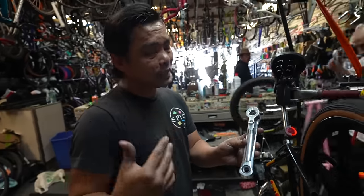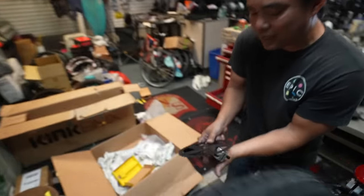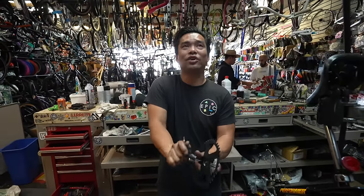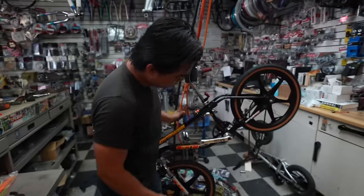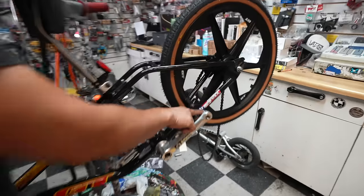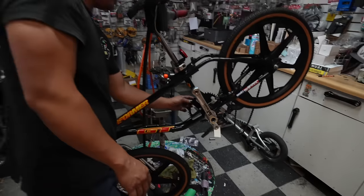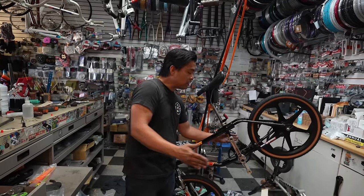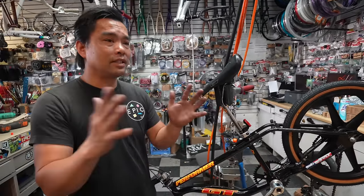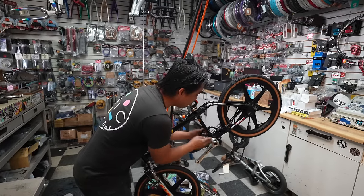R for right. One of the key things I want you guys to remember: there's a lot of space over here on this side, and a little bit less on the other. Because I was the one to tighten this side, there's still a little bit of room for me to pull that spindle over. You always want the spindle to be a little bit below — that's the one to compress. Otherwise, that's the problem where some of you guys tighten it up and the crank's a little bit loose, or the sprocket's a little bit loose. When you tighten it, you're bottomed out on the spindle — you need to take it out and put a little bit of spacer in there.